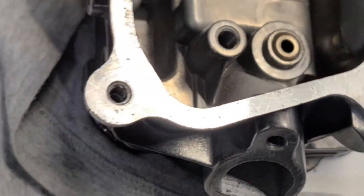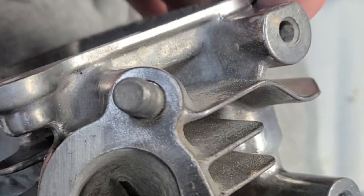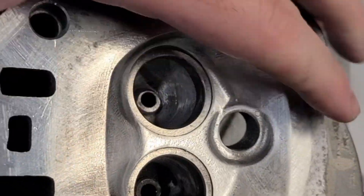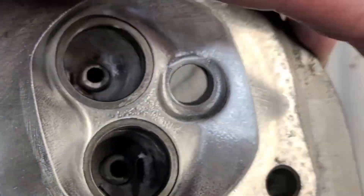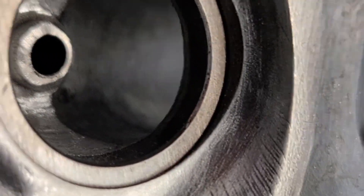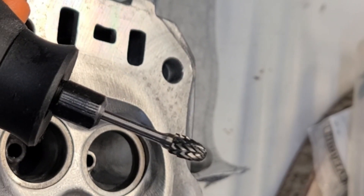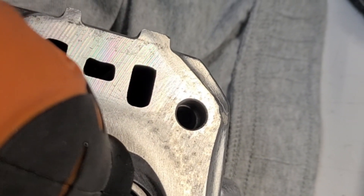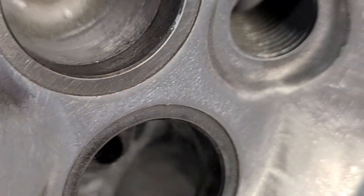Here's an update: I port and polished the intake and exhaust ports to give better airflow and air-fuel mixture, and polished the cylinder head with a wire wheel. To port it out, you need a tool like a Dremel with carbide burr bits. You carefully get inside and take off a little bit of material — just grind around and open up that port.